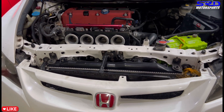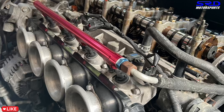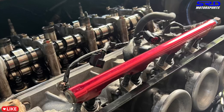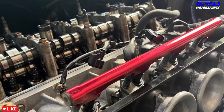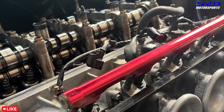The owner and I agreed we need to rebuild this since it's been well over a decade. We checked the lash and tappets and they look good, but the cam is clearly not stock. I called the owner and he confirmed it runs Drag Cartel cams, though he can't remember what stage — we'll find that out when we do the full build.